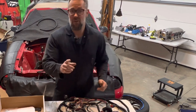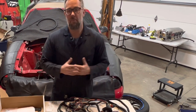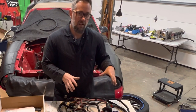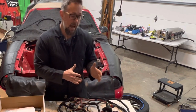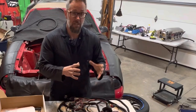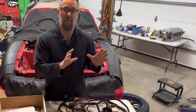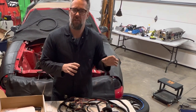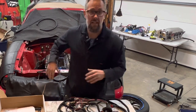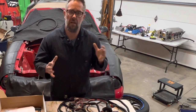The other service they offer, if you want to make your life even easier and your factory wiring is in decent shape, is a plug-and-play option. MF Customs makes a proprietary adapter — you remove your factory computer, plug in their adapter, then plug in the Holley Terminator computer. Boom, everything is functioning. There might be a couple of wires to add, but otherwise it's basically plug-and-play, with the Holley using all your factory wiring to function. That option is a little more expensive — I think around $775.